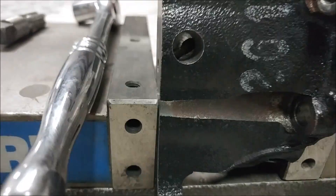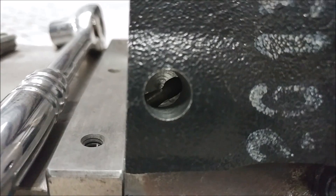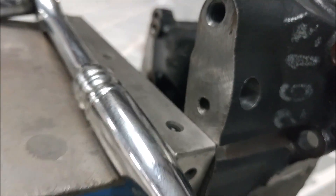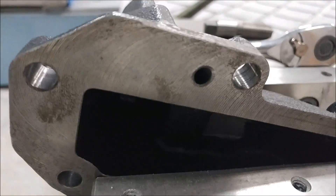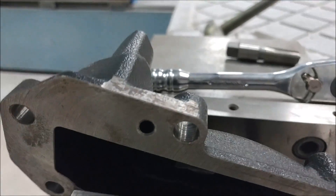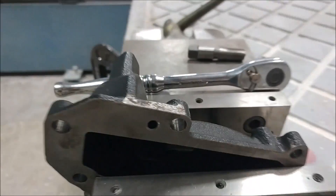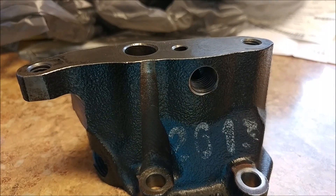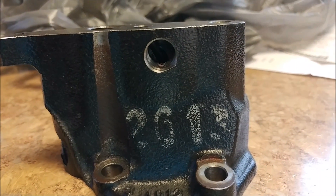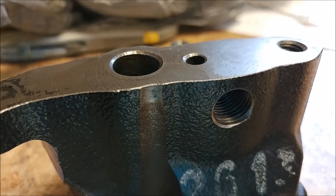Welcome back, back in the shop after Sun & Fun. Last time I was working on this bracket — this is now the oil feed line; the last one was the oil return. You can see I've tapped into that little tube that runs diagonally, which feeds the stock turbo. Now I can put a fitting in there and connect the turbo setup. I needed to tap that, and you can see it now has the thread in there. Basically just going to hook up a fitting and feed it through a Y-connector.